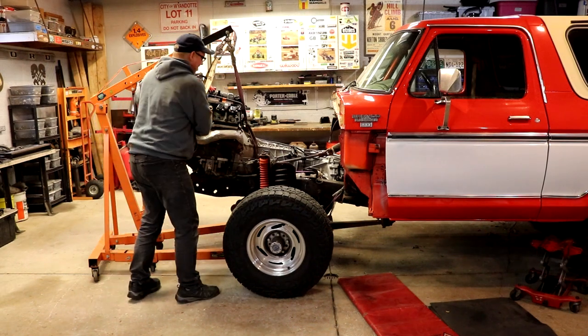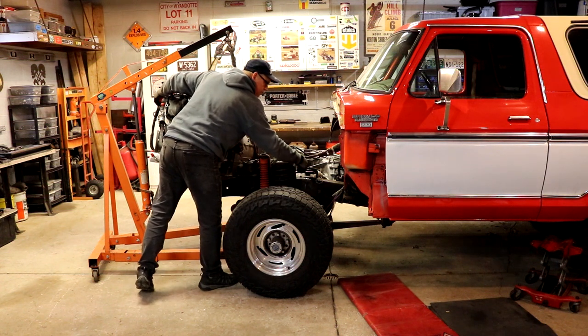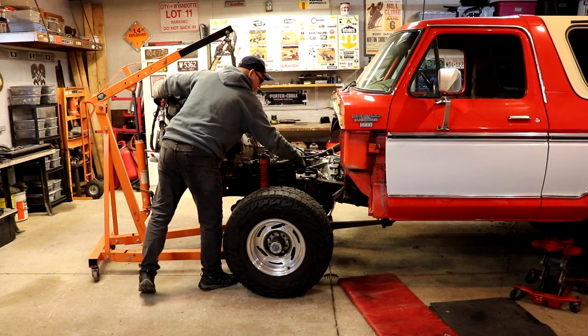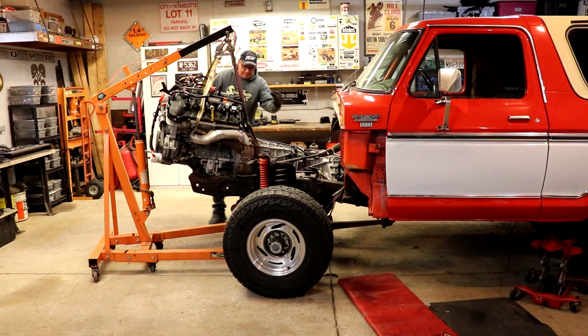Now that I know what's going on I can pull this whole engine out, clean that up, get the flat plates on - I'll make a centerline mark. I have the centerline marks of where I want the motor mount surface to be cleaned and welded flat. I got the one over here marked where I want it. They're actually staggered on the coyote engine - they're not in line - but that's okay. I'm going to remove a couple of bolts, grind it all clean and flat, weld the plate over it, put the bolts back in so it'll be as strong as ever. Same on this side.